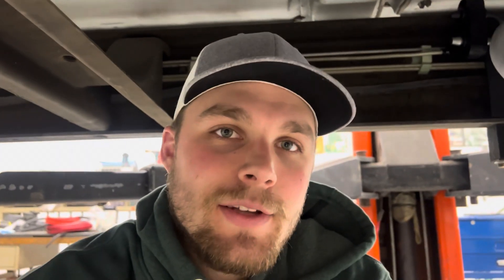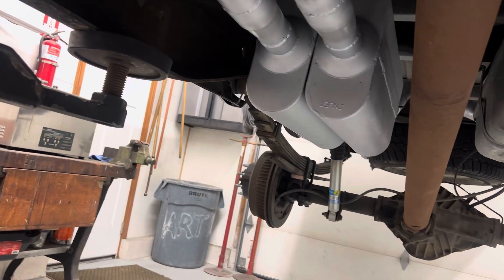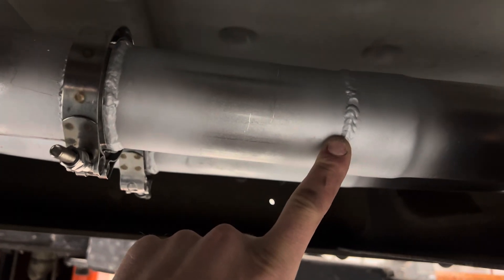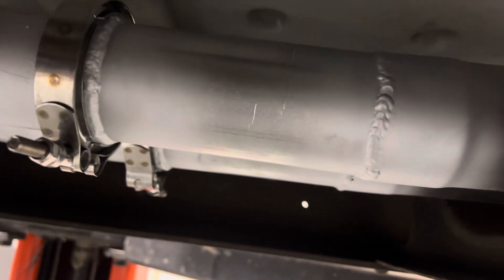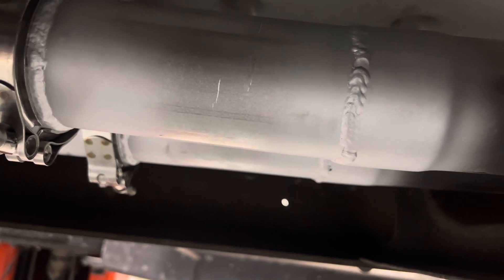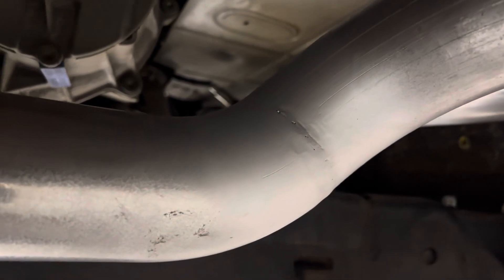I think it's safe to conclude that neither of us are welders, but a grinder will clean up what a welder can't do. With that said, we can admire this finished exhaust. As you can see, we got the entire thing done all the way back — all the joints are welded. The welded joints have a high-temp coating on them because the welds are not stainless, they're just regular steel. The wire in the welder — I don't remember what it is — but they will rust, so those are coated. These ugly welds are ground down; they're still not pretty but not as ugly as they were.